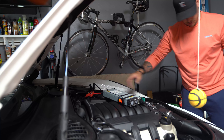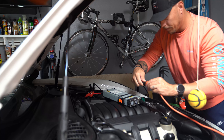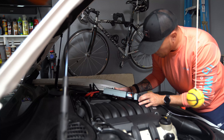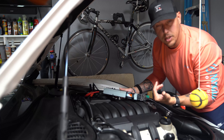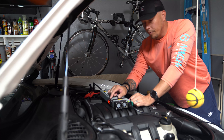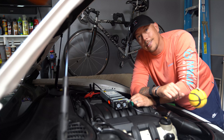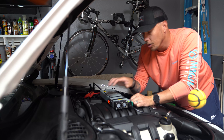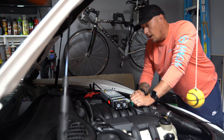You'll see it pop on as soon as you touch it to the battery. We'll go ahead and plug it in. As it starts to build up — right now it's at 12.6 — you'll see it slowly start raising. The reason I built mine this way and put my voltage adjuster here is that you're always sitting in the car when you're doing your PIWIS testing, calibrating, and troubleshooting, so it only made sense to put it where I can look through the window and see my voltage.